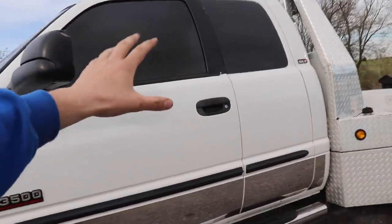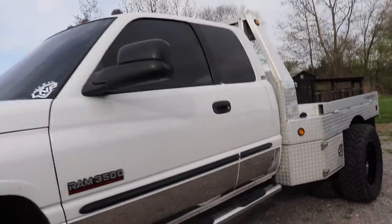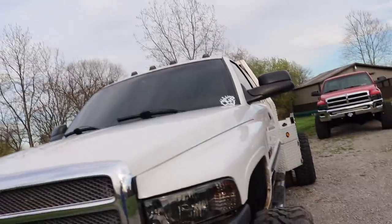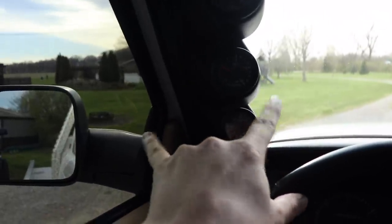What we did is five percent on the driver and passenger side main windows, five percent on the back glass — it looks really good. We also did five percent on the completely back of the cap. Not that you can really see the back glass with a headache rack on there, but we did do five percent. On the front we did, I believe, thirty percent. Of course, if you've ever had five percent, with the doors closed and the camera lighting settled you can see the difference between five and thirty — quite a bit of difference.